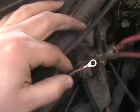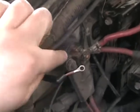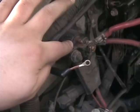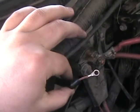This line is 12 volts coming from the ignition switch and it tells the starter relay here to click on to start the truck. I wasn't getting 12 volts here. Found out that my DTR — Digital Transmission Range sensor — which is on the driver side of the transmission right under the floor pan, was not lined up properly, so I fixed that. My dad's fixing the terminal because it's rotted off, and hopefully the truck will crank.